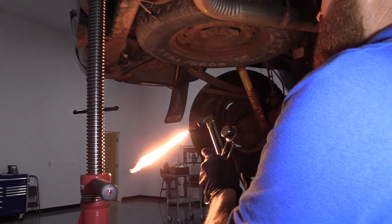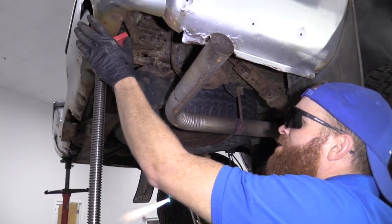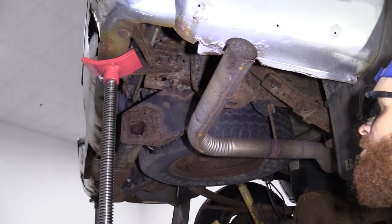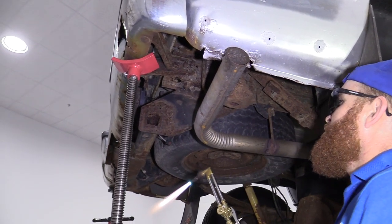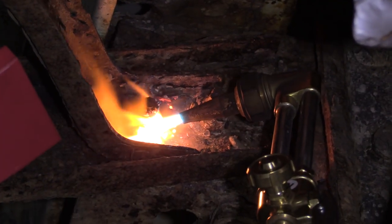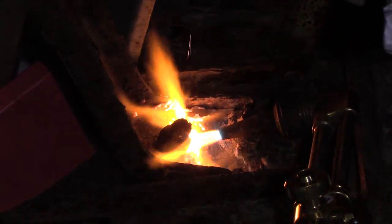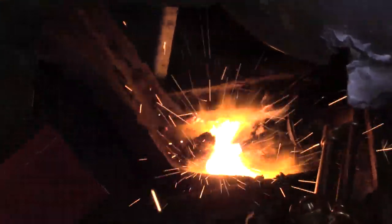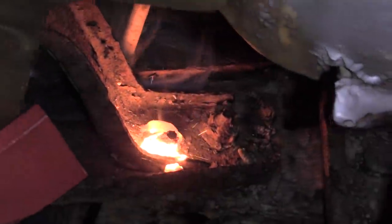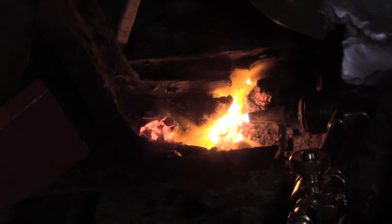Get our torch ready here. I forgot to mention that we put a couple of supports underneath the bumper here — that's just to help make sure the bumper can't go anyplace once we get everything cut apart. We've got our safety glasses on, special torching glasses, hand protection, and we're going to keep our mouth closed while we do this. We need to get this cherry red, looking like it's starting to almost turn to liquid, and then we can blast it and it should start cutting this away. When you first start cutting on something that's rusted, it pops a lot and shoots little sparks out, so just be careful for your face.